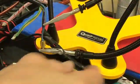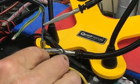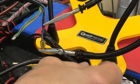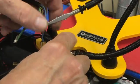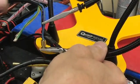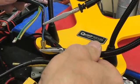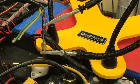The most difficult part about putting on bullet connectors is this gets really hot. So I've got this octopus kind of, it's called quad hands, and you can see the wire going into the bullet connector. So as I heat it, I'm going to take this particular hand of the quad hand and raise up so that wire goes all the way down inside the crevice, or the divot.